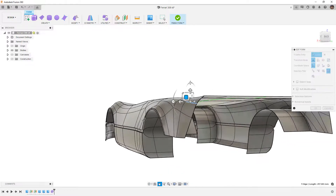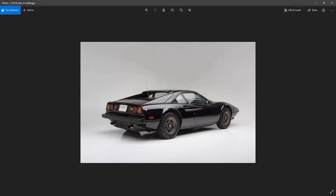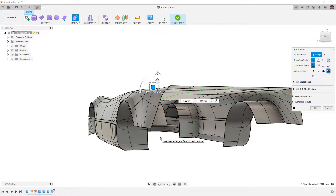When we transition to underneath that style line, everything's going to start to roll back under. The back of these cars is actually fairly open. Looking at the back of an original car, you can see it sort of flares out right at the back. This panel here doesn't have a lot of body lines — it has a little seam on the back and it rolls in. All the rest is open for the engine, exhaust, and everything back there. So we're going to leave it open and carry this panel down and under a little bit.